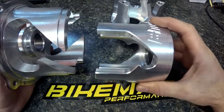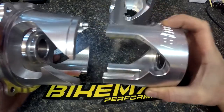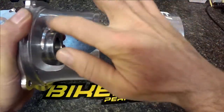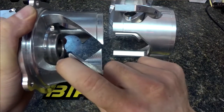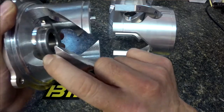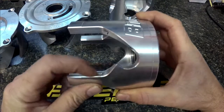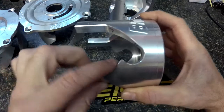In any engine reverse function, the engine goes backwards on a two-stroke, so it starts going backwards. When that happens from low gear, the roller will catch in this little notch right here and prevent it from upshifting while you're in reverse, to limit your speed and give you more torque in reverse. The other outboard helixes function the same way — the roller will hit this portion before it goes back.